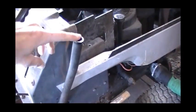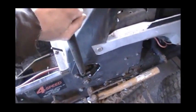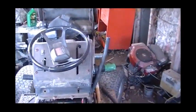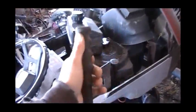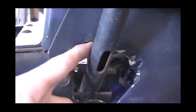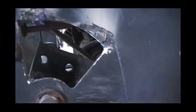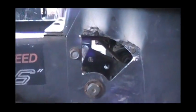I will say one thing I wish I didn't do is trim this yet, because I just had a really neat afterthought. The idea of this going back and forth is pretty cool, but there's more of a tendency now to hit this thing because it sticks out pretty far. So I sort of wish I left the old button thingy in the top and had that little plug there. Because what would be really cool is to cover up these notches right here with welds, and put a new notch right where it's sitting when it gets into neutral. So if I put a little notch in the metal right there, that pin would lock up and lock this whole transmission in neutral, making it so you wouldn't be able to kick it into reverse or first gear on accident. Notches are all closed up. Now I'm going to test fit the other handle, figure out where neutral is and grind a new little neutral notch.